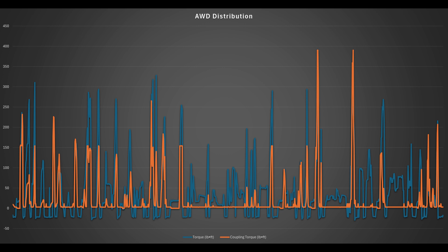To quickly recap the system: we have an AWD setup where the driveshaft is constantly turning every time the ring gear and differential turn. The coupling or clutch that pulls power to the rear is mounted on the rear differential. There's a gear ratio difference between the power transfer unit and the rear differential, and we're overdriven in the rear by 1.1%. Engineering Explained has a great video on how a similar system works on the GR Corolla — the GR Yaris and Corolla are overdriven by 0.7%. His video is great and explains how the system can actually pull more torque to the rear than the front when needed.